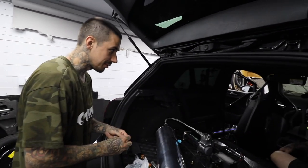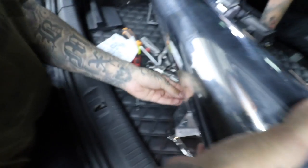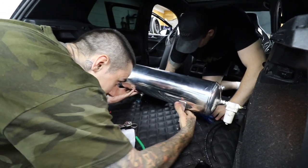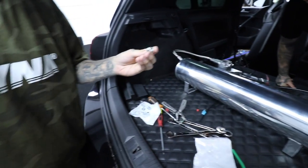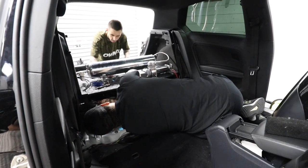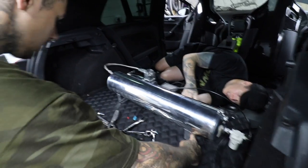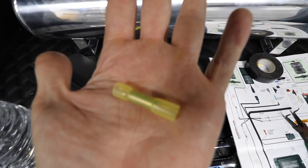Once all this is bolted it's going to start looking savage - the back is basically done now, working forward. We've got these bolts that go on the top with washers. We're going to do the first side first - looks like a 13. These connectors you get supplied with the air kit - you put both ends in, crimp the metal on the inside, then heat-shrink it up, and then to be on the safe side we're wrapping it in this after. So even though it looks like it's just electrical taped, it's actually been crimped and heat-shrinked on the inside - do not panic.